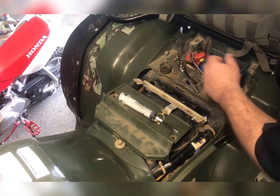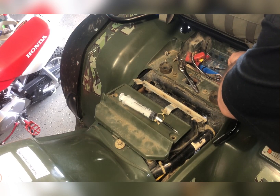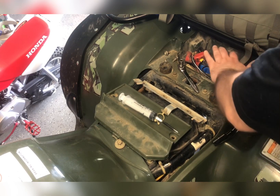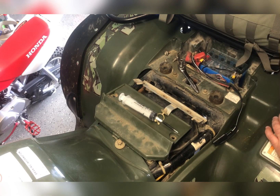After a quick look and a quick shake, this battery is actually full of water — all the cells are full — so I don't have to worry about rehydrating this one. The one on my motorcycle needed quite a bit of fluid, so I'm glad I took it apart and put a little bit of distilled water in it.